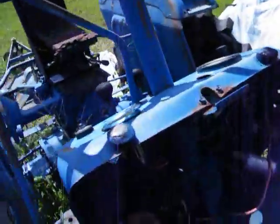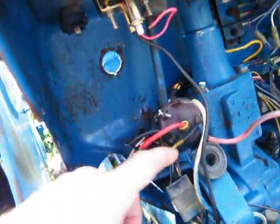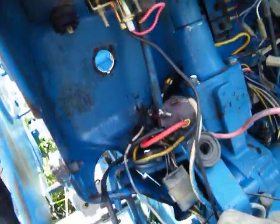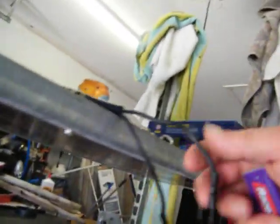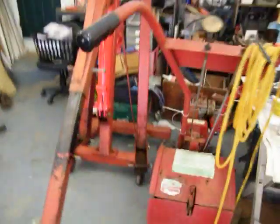We'll check the wiring on all this. Going inside real quick — the glow plugs should be on 17. I know you can't read it, but we have AC, and then you've got 17, 19, and 50, and 30 in the center. One side of this should be on 17 and one side on 19, so that when you turn the key backwards it sends juice to the glow plugs.